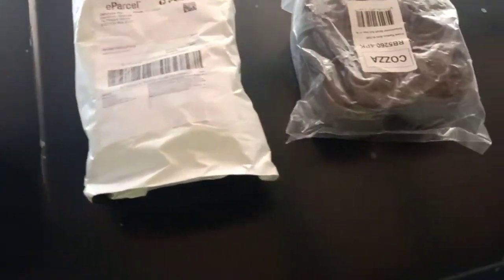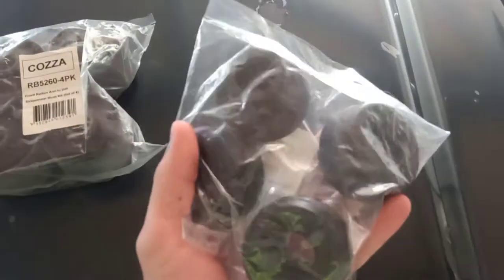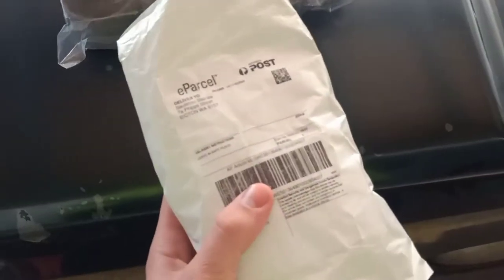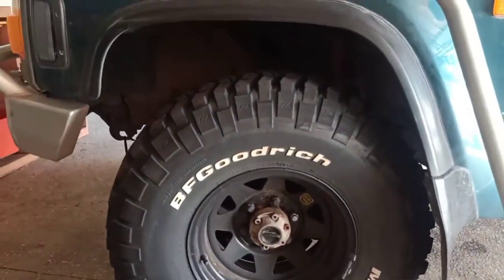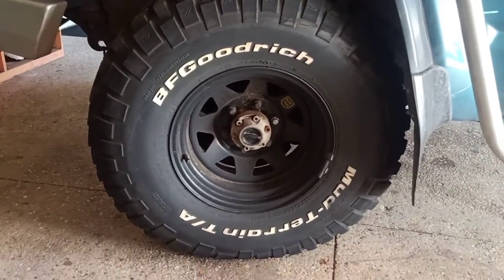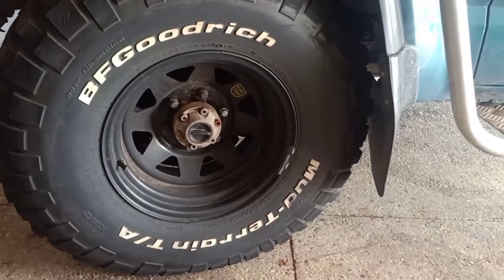Got a few load deliveries, a bit of stuff to do on the Barra Patrol. New front radius arm bushes — they're zero degree caster correction because I'm running minimal lift. If anything I'll probably drop it down, put some softer springs in just to make it a bit nicer on the road. Got new radius arm bushes for the chassis-to-radius-arm mount. In here I've got 15mm spacers — that springs the wheel forward by 15mm, which helps because it's quite close to the back, and that'll stop it scrubbing there. That's the plan.